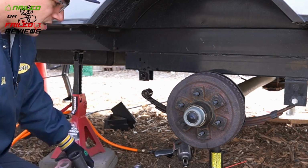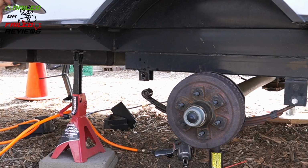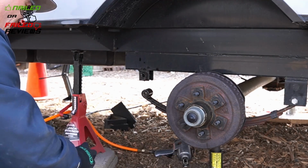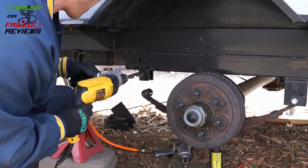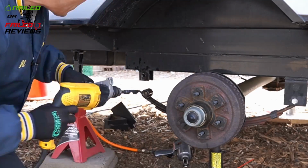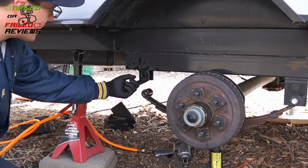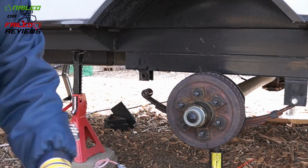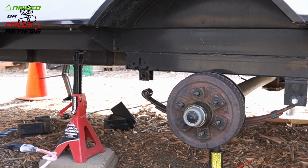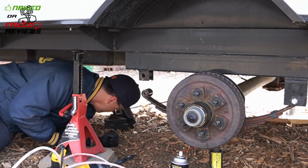For me, I determined I could drill an 11/16 inch hole. I could get a bushing made that was just over 11/16 inch outside diameter. The inside diameter was just over 9/16 to accommodate that wet bolt. And then as you can see here, what I did was I just drilled out each tab individually so I could hopefully not make the hole any bigger than what it was going to be just by drilling. But because you're hand holding it and not super steady, it is going to be sort of bigger.